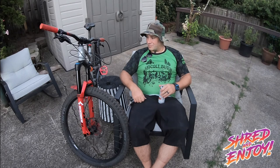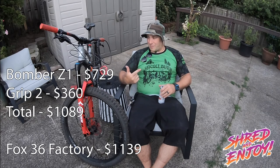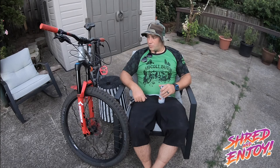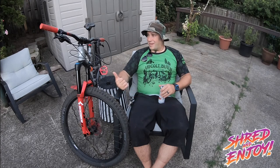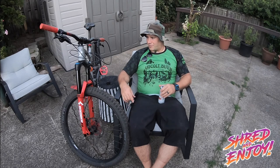Final notes: overall I endorse it. It works good, it does the trick, I'm happy. In theory this was supposed to be a budget option to goof around with, but when you add the coil and the Grip 2 damper, I might've spent as much as a Fox 36 — which I already owned. For the viewer at home, this might be a bad idea if you don't have to spend that money. But if you're really into coil, maybe a heavier rider — coil works really well for heavier riders and I'm inclined to agree — I'm around 240 pounds and it treats me really well. Highly endorse it.